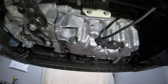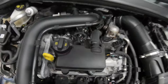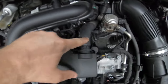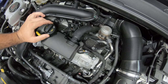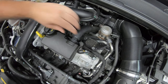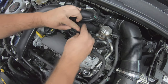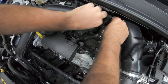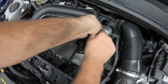Now we can go onto the top of the engine and change the spark plugs and the air filter. So next we're going to tackle the spark plugs. On this little three cylinder engine there are three spark plugs — you can just see the coil packs there. To get tidy access to the coil packs, first we need to take this breather pipe off. You take this off by pressing the two sides of the pipe and then pulling it back, and it'll unclip. Then just stick a cable tie around the pipe to hold it out of the way.